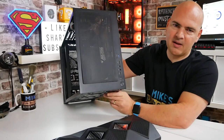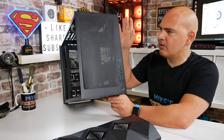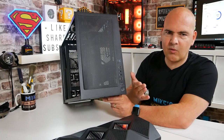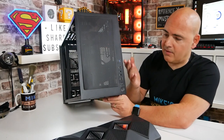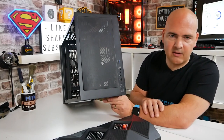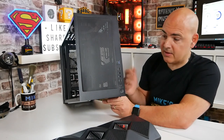When it comes down to I/O, I think realistically, most people, if you're plugging in USB 3 devices for reliability, especially if you're doing things like streaming or data transfer, the rear panel connection on your motherboard is probably the safer and more reliable way to go. USB 3.0 on the front is probably going to be used maybe for just a quick transfer from a thumb drive, that kind of thing. So I think one port is absolutely fine. And again, for the other two there, maybe some kind of addressable RGB mouse pad, or just plugging in things like a microphone headset, or maybe even a gamepad, where it's going to be regularly used. I think that's absolutely fine.